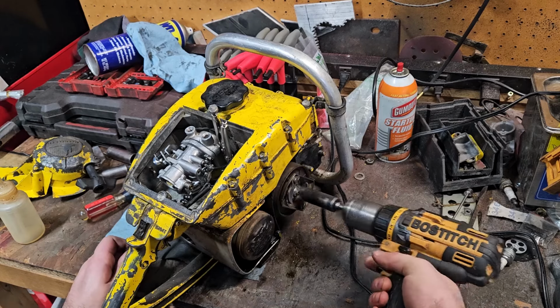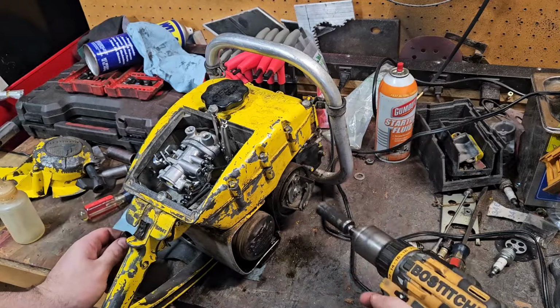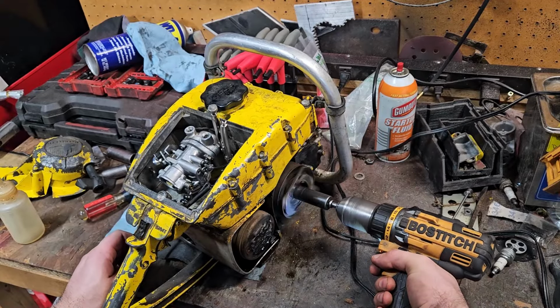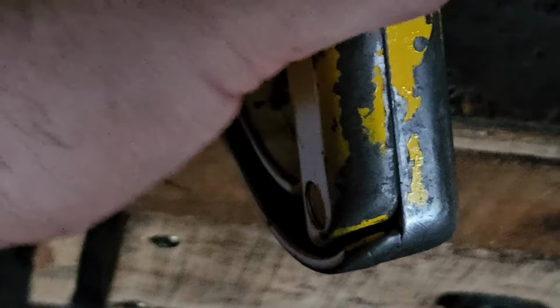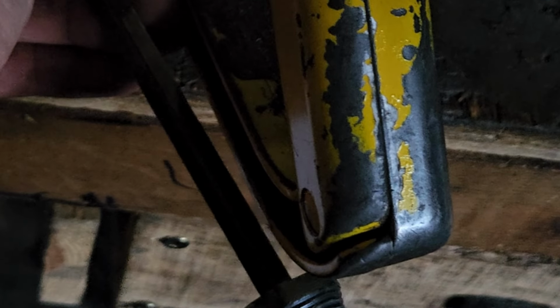Okay, so I installed the carburetor and tried to get it started. And later I find out what the issue is. I lost a half hour of recording, let alone a couple hours, figuring out what is going on. And it turns out the points on this are kind of special with their gap size. But here we go, at least hearing it start to run.